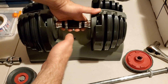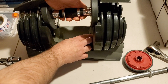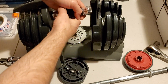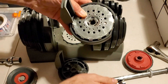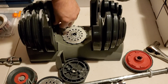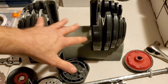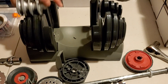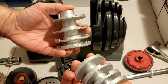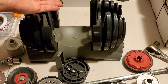Just be super careful as you're pulling up — remember this is all going to want to come apart. There's my other ball bearing, and there are the springs. Fortunately they didn't go bouncing around. There are my other two ball bearings. You have to be extremely careful that you don't lose these, otherwise you'll be buying a pack of a hundred just to replace two of them. Now basically what remains is a bunch of discs and your weight, which you can pull out — in my case they came out together as a pack.